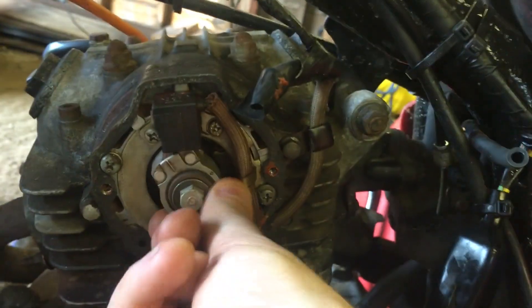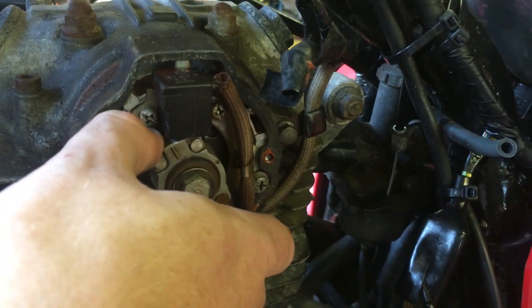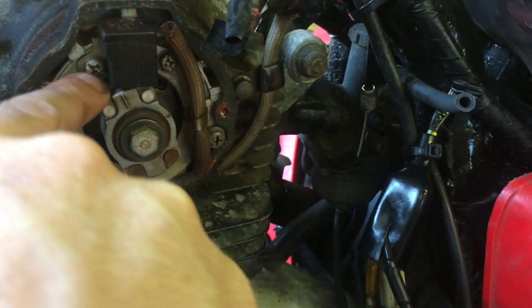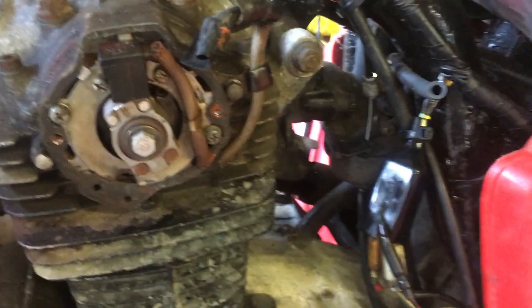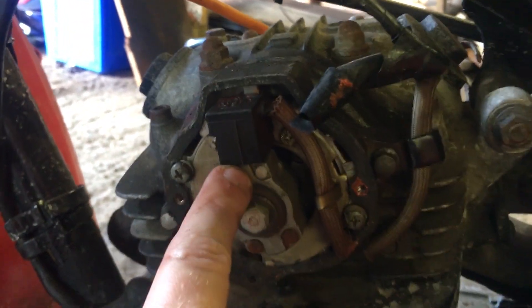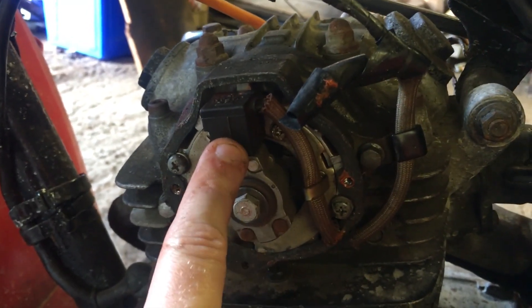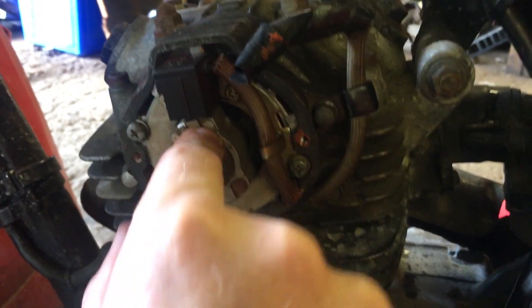Another thing — if the top of this sensor right here, visible in behind, if this little part of the rotating magnet is dirty, you might not get a spark, or you'll get an intermittent spark. Also very important is the gap between the top of that bump and that little sensor. I'll take this apart to show you, but that gap has to be between 15 thou and 25 thou of an inch.